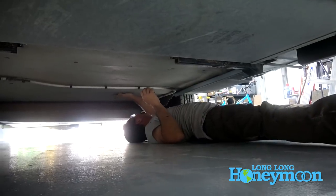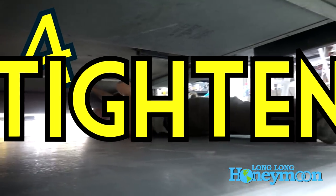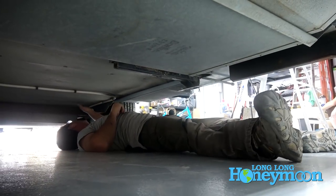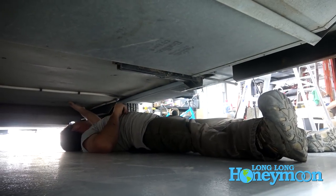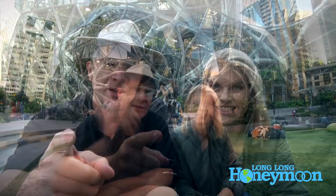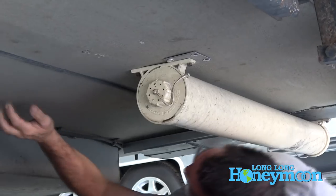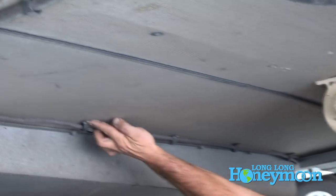This wants to leave the vehicle, so we better re-secure it with larger or additional rivets. You need to tighten up loose screws and refasten loose panels. Traveling down the road is like a little earthquake — everything is shaking. Hit a pothole and all that vibration transfers up through the coach and things work themselves loose.